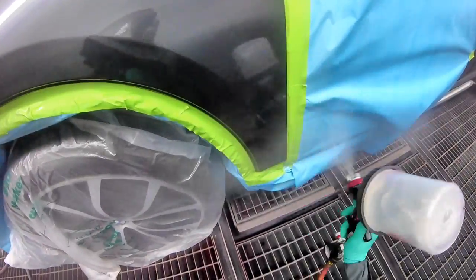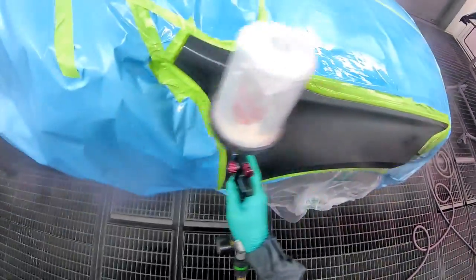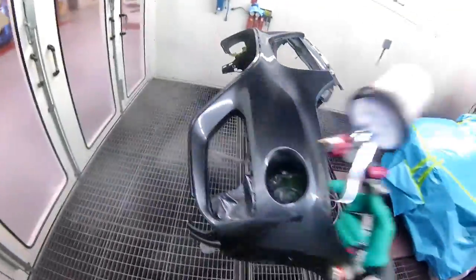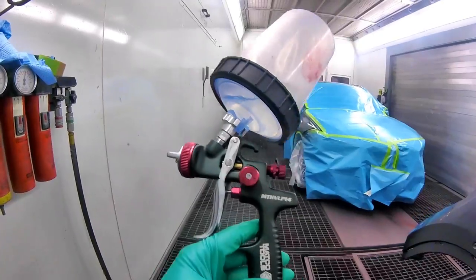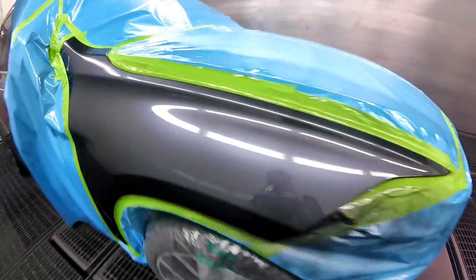This is just my opinion, so don't send me hate mail because I said something. Honestly, this gun for base was the best. I tried it for sealer a couple of times. I tried it for clear a couple of times, but the best application I saw and felt was for base. But if this is the only gun that you had, you would be okay — honestly. So I'm spraying right now at 30 PSI. I clearly remember setting it up for 30 PSI because I wanted to see how it performed. It performed amazing at 30 PSI. At 25 PSI it was a little bit too orange-peely for my liking, but it still laid down a beautiful job. There's not much overspray. The gun was really doing a great job with the transfer efficiency.